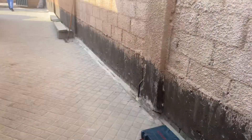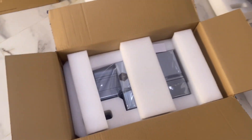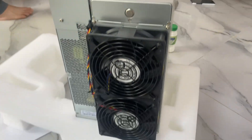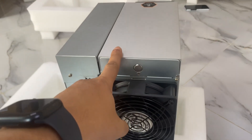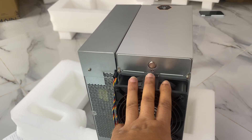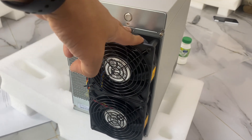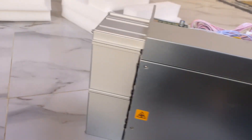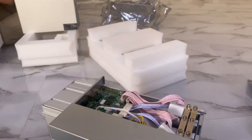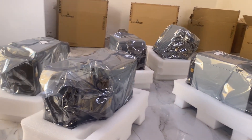In the meantime, we're going to prepare the miners. These are brand new, so we just remove the fans and prepare them for immersion. We need to open the cover for the control board, remove the fans, and install the fan spoofers. Since these are brand new, we don't need any cleaning — they go straight into the immersion tank. Fans removed, fan spoofers installed, then put the cover back. Do the same with all the miners and we're ready to put them in.